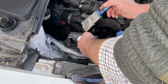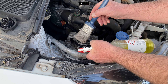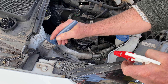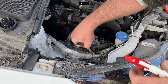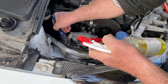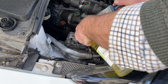There's a bit of residue around there - we're going to wash it down with a watering can in a minute. That coolant bottle has been leaking for at least six months. It's been getting worse, and if you don't change them they will just split and you'll lose all your coolant, which is not a good thing in your engine. This car's only got 30,000 miles on it, so it's a fairly new engine and fairly new car. Get rid of all the coolant debris - what you want to be doing in a week or two is making sure you've got no other coolant leaks. By getting rid of all the old coolant residue you can tell if you've got a leak.